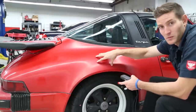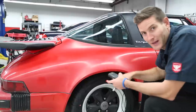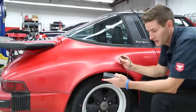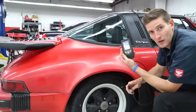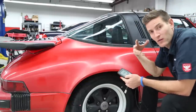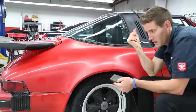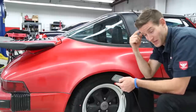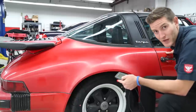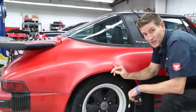Here's a small example of what I'm talking about — this area is really, really white compared to this area. This has been repainted and it certainly looks that way from experience. I'm taking my PosiTector from DeFelsko, putting it on there, and it's telling me it's about 8 mils. The door is about 4 mils, and around the rest of the car it's about 4 to 5 mils, which is typical of these older Porsches. When it goes up to double the mils instantly I say it's been repainted. This is degrading at a different rate than the factory paint, meaning somebody in some random body shop painted this single stage and it didn't quite work out.